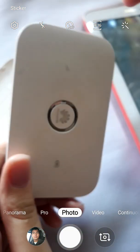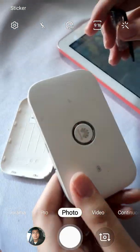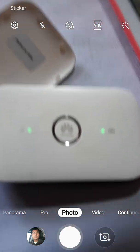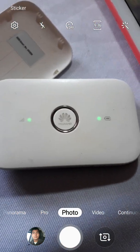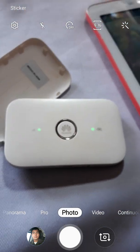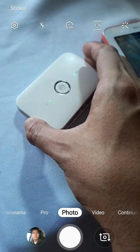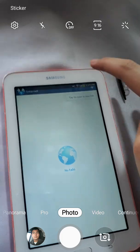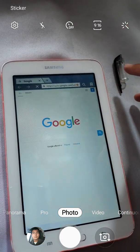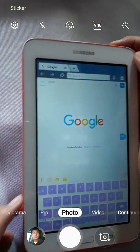Let's see if it's rebooted already. It turned off and then that's what we like — it turned off and then it turned on. So after that, wait for about 20 seconds, then connect to it by turning on your Wi-Fi. Now you don't have any password at all, so if you click on your modem name you could connect to it.